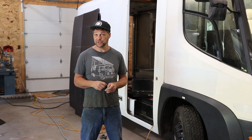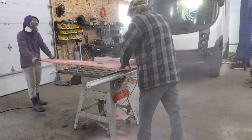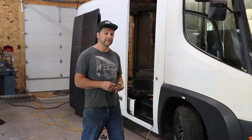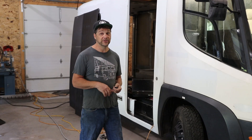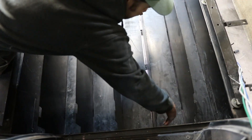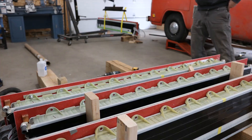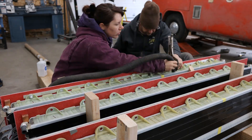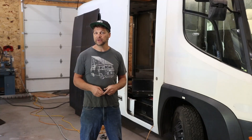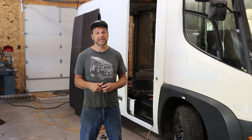The batteries are secured. There's first foam insulation, then a quarter inch of fire-retardant arc-resistant fiberglass, then a half inch of rubber for shock absorption, and then more foam on top of that, so the batteries can really sit in their position. The batteries are also supported from the top, so they kind of dangle and they're kind of supported. We wanted to make sure that with bumps and all the rigors of driving, the cells are in a position where they're not getting stressed in any way.